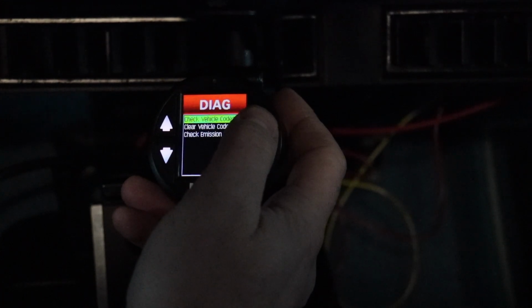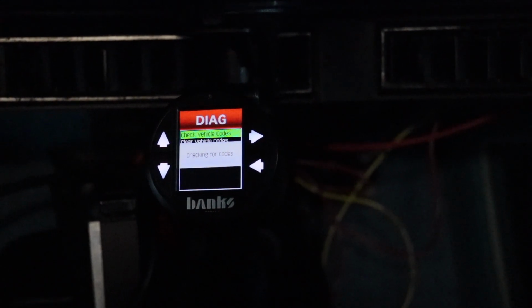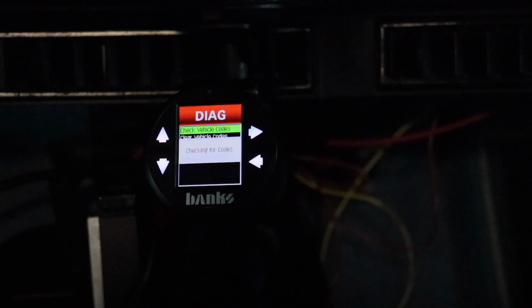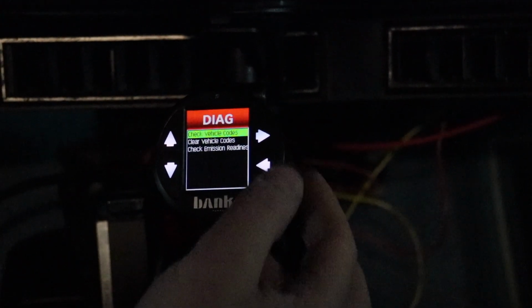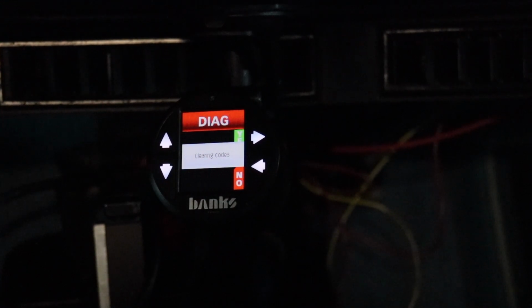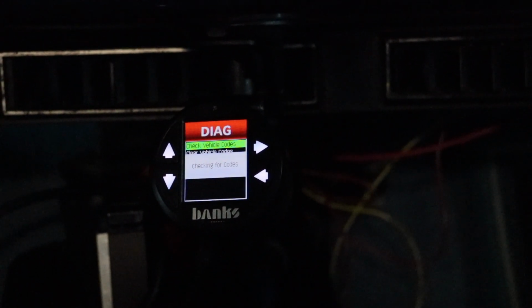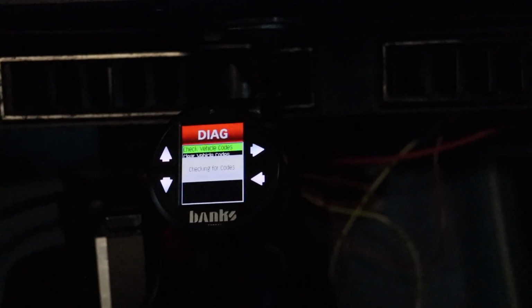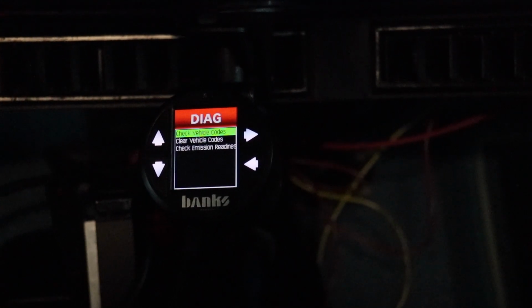One thing I don't cover in this whole video is the data logging feature of this. I haven't used it much, so I don't have a lot of feedback on it, but it is one of the other reasons I purchased this. It's a much easier option for me to have continuous data logging for diagnostic purposes. And on diagnostics, one thing that could take care of the check engine options here is if Haltech updates their software to where you can actually send OBD2 on the Haltech CAN bus, where you can have the Haltech dash. Okay, so you can actually clear codes and check codes in this kind of mode. And this is running through Haltech's auxiliary CAN bus. So this was a feature I was hoping for underneath the Haltech CAN bus, where you can get most of the data.